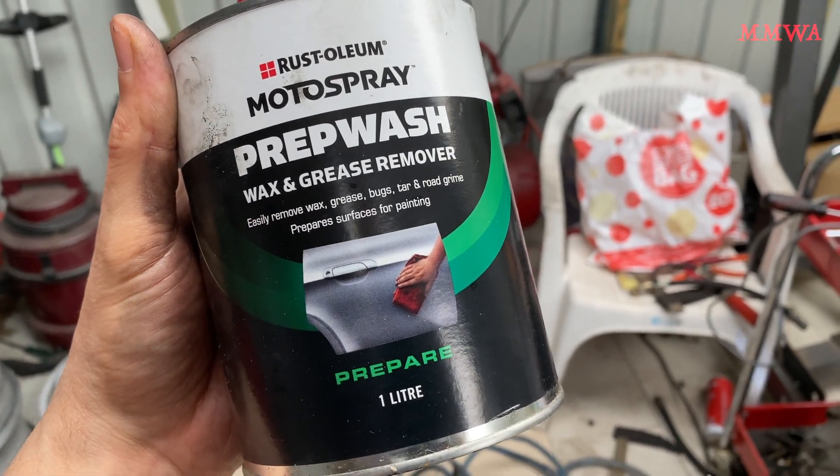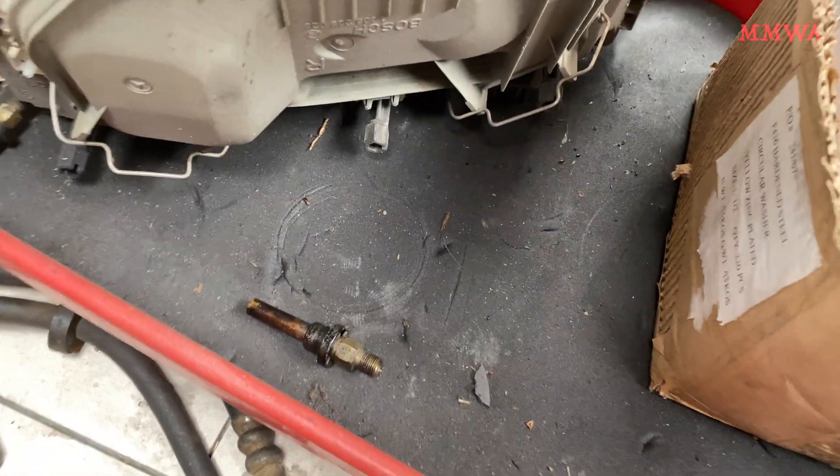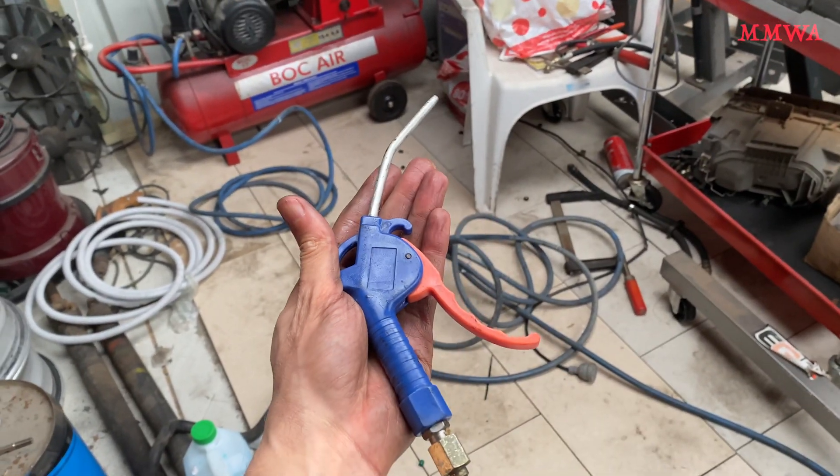So this is what I was using for that last test. I would not recommend that, because that's not good for the injector — no doubt. And it's contaminating it with bits of rubber. I'd be using kerosene or diesel.